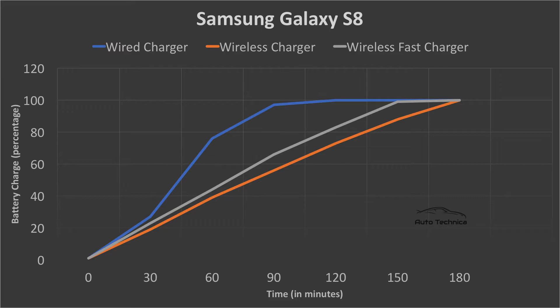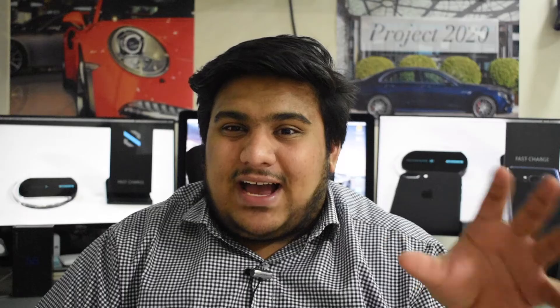The results are actually pretty surprising. I expected the S8 to do a lot better since it actually supports fast wireless charging, but it took two hours and 40 minutes compared to two hours and 59 minutes on the normal wireless charger — only about a 10 percent difference. I used the out-of-the-box power brick with Qualcomm Quick Charge for the Samsung, and the five-watt out-of-the-box power adapter for the iPhone. The iPhone was surprising — about 20 percent faster than the normal wireless charger, at three hours 56 minutes versus four hours 32 minutes.